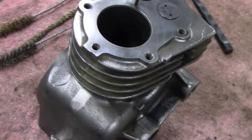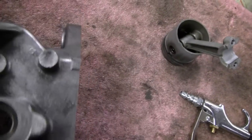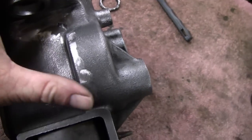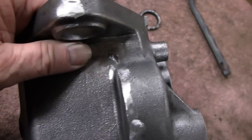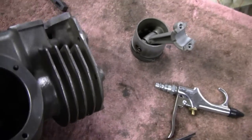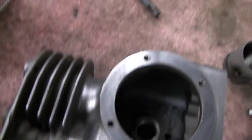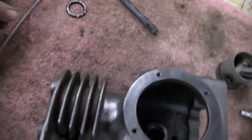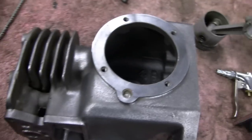Let me see what I can do with that. I cleaned it up a little — this side will pass, it looks okay. And this side, not much I can do with it but it does look a little better. I call that good — I'd say it's ready for paint. To get inside these fins, you get these little wire bottle brushes and they'll fit right inside there and clean that thing right up. Good to have in a variety of sizes — just two brass ones and here's one steel, but they're good to have around.